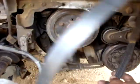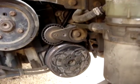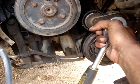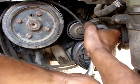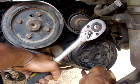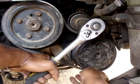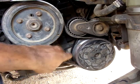The last step will be to install back this belt for the AC compressor. Remember to use this Torx bolt to pull it up and install the belt. And that's how you install this belt.